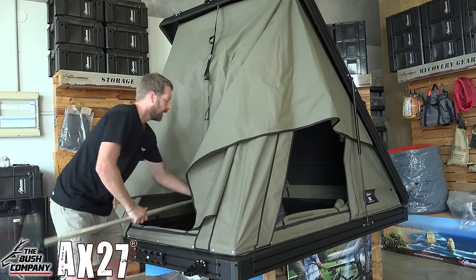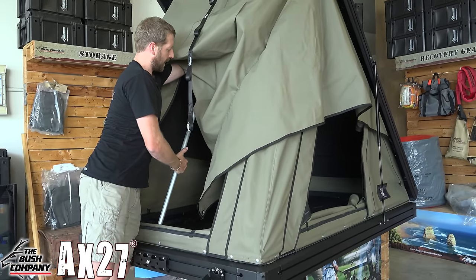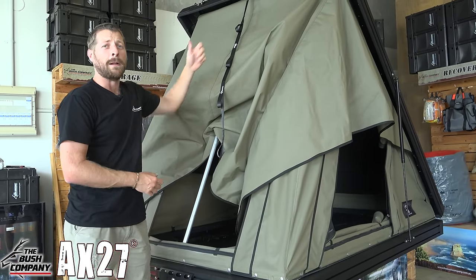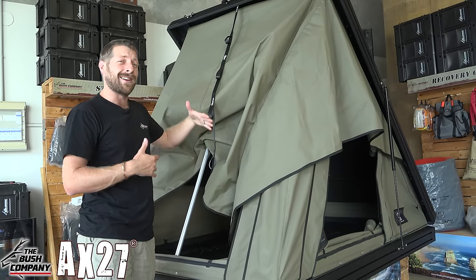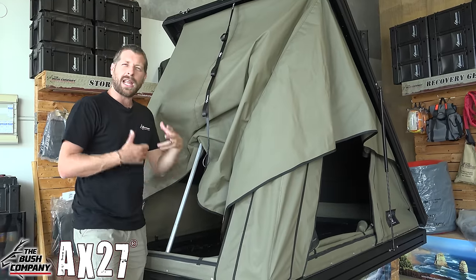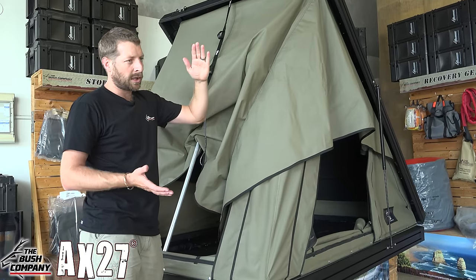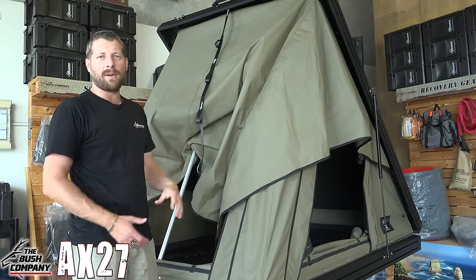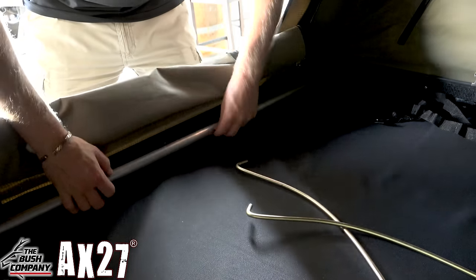Now, as far as these go, the main reason is for the snow conditions. So if you are in the countries where it snows and it gets cold, you can prop that up on the base of the floor and on the underside of the roof. And especially because we're bolting solar panels and other products on the roof, snow is going to gather on the top of the roof of these tents. And if it does gather, these are just giving you that extra support. Being heavier than the 50 kilograms once all the snow's on there, the tent will slowly start closing down in the colder climates, where that manual pole just stops that from happening. Very simple and very easy to use. Now that we generally fold away and tuck it behind the headboard.